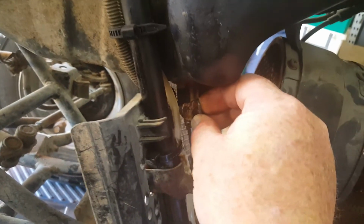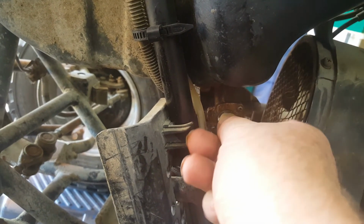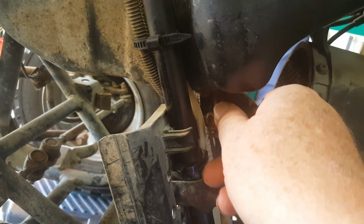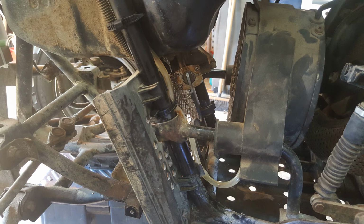The idle speed was way too high, and I'm guessing that's because it had way too much fuel going in. It didn't need any choke, and it just ran. I wound the idle adjuster right out, and it wasn't slowing it down. I reread the workshop manual, and there's a couple of things I think I can improve on, and I will do that in the next video.